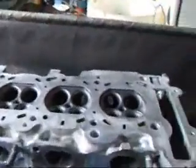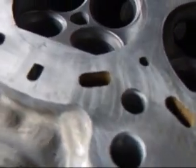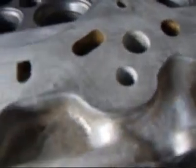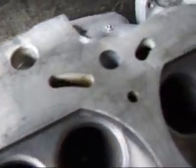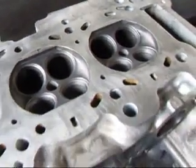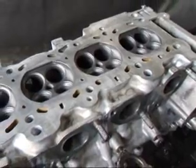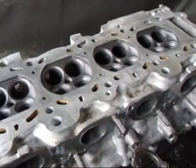We did the block a little while back, and I want to show you kind of the same problems that we have on the cylinder head that we had on the block, which was somebody took a Scotch-Brite pad to the thing. If you take a look here you can kind of see the sanding marks from the Scotch-Brite pad, and whenever you do this it's going to cause a problem with valleys in the surface which are not going to allow the gasket to seal very well. We're going to throw a little bit of graphite on here so we can kind of see what's going on, and then we'll resurface this head.